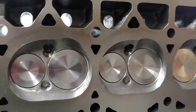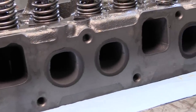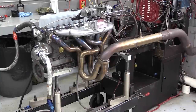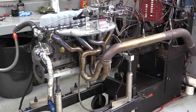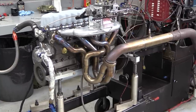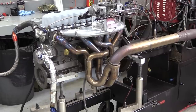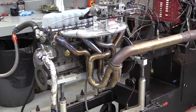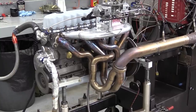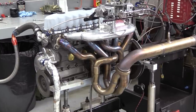Although it is more modern, this head can actually be difficult to make power with because the exhaust port has been shrunk. Here's a standard exhaust port — compare it to a Tuffy exhaust port and see how much smaller it is. And remember, this has already been ported about as large as you can go. The head is bolted to a stroker combo using a 4.0 block with a 3.875-inch bore and a 4.2 crank with a 3.895-inch stroke, combining to make this straight six 275.6 cubic inches. It uses shorter rods from the 4.2 liter engine and cast hypereutectic pistons for a 4.0, making the rod-stroke ratio lower than with longer 4.0 connecting rods, which doesn't really help power — but it is a common combo, so we need to account for it.